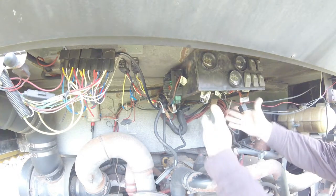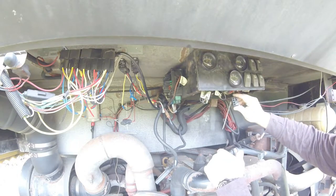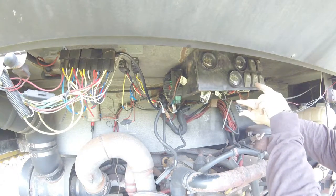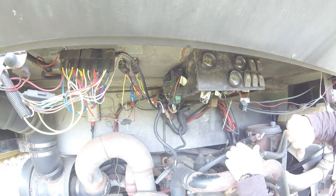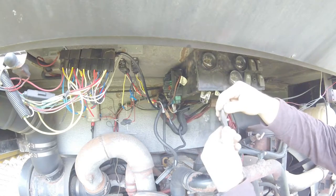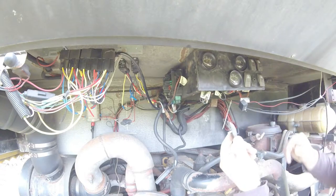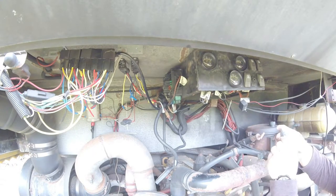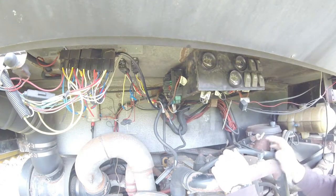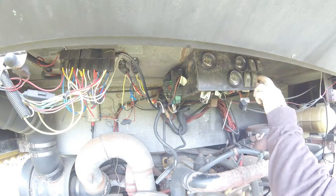I got the cover off — had to grind the screw heads off and pry it off. I did find some nasty corrosion; a pin is corroded completely off of the back of this ignition switch. These switches say 'Thomas ignition on and off,' which is cool that it has a labeled rocker cover. I believe that cover is broken and would need to be replaced, but the rocker switches themselves are removable — I could get replacement covers, but probably won't.